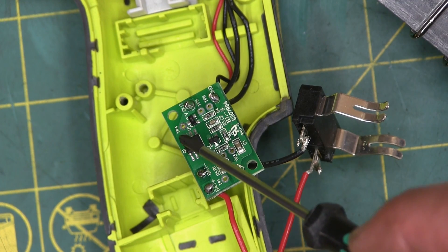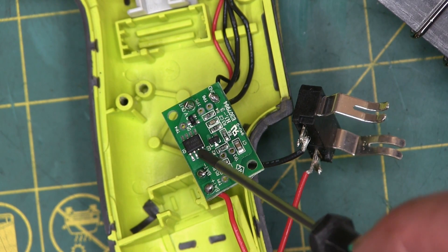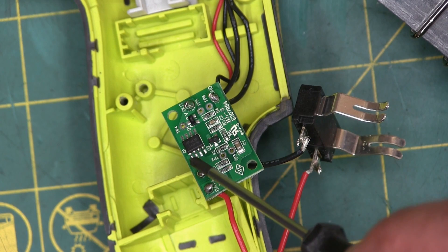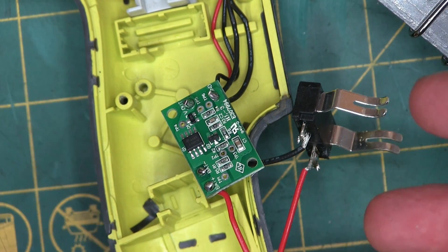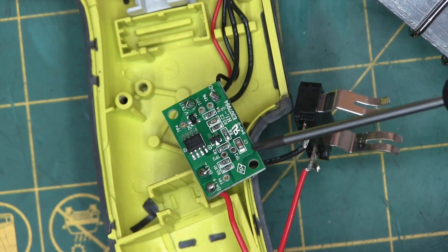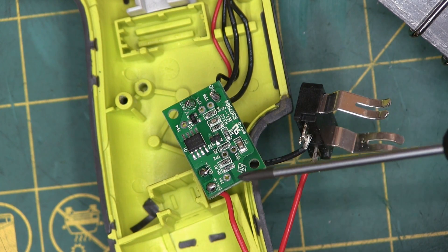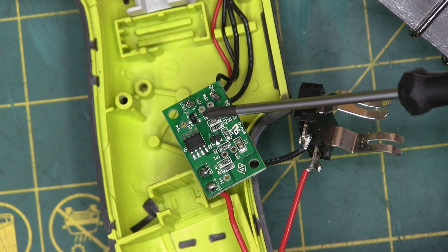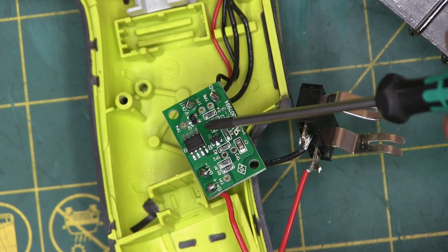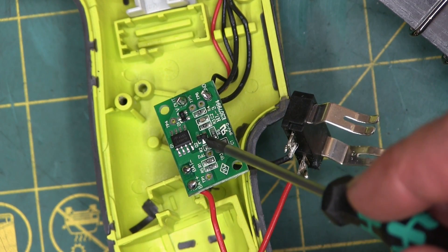What appears to be happening: this MOSFET here has the gate, the drain, and the source. We take battery voltage in, this little guy turns it on, and it's just making and breaking the current. Instead of a nice dumb switch you can easily troubleshoot, now of course we have a printed circuit board. There's really nothing going on here — some test points, battery in, battery out, a little diode for snubbing inductive kickback when we open the circuit. Nothing on the backside, just one little via and a little jumper over to one of the drain resistors for the gates.